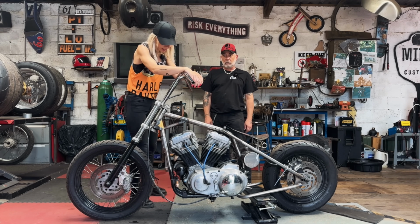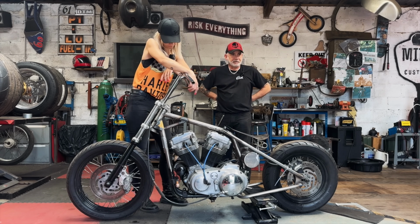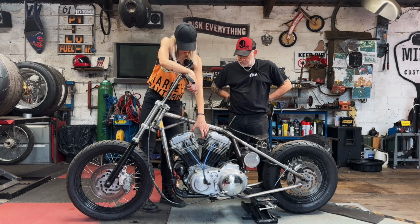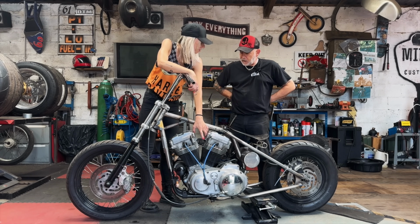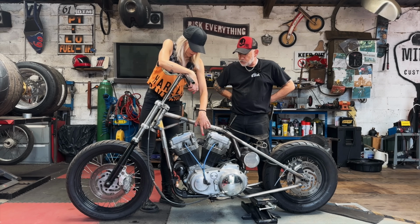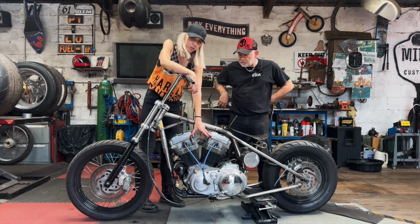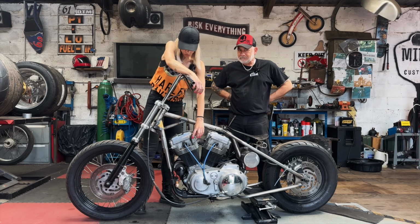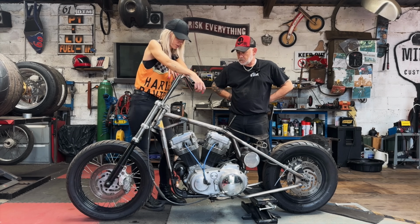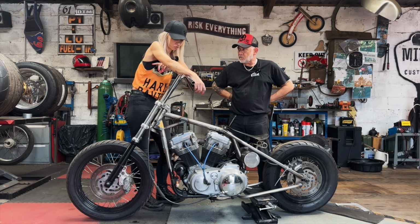But today's plan is to do a bracket for the coil, a coil mount bracket. And also, we need a little bit more strength in between the engine heads. Yeah, head steady. So that will come down there and it will be here. I looked at the different Mini builds, how Simon did engineering solutions of a bracket. And I really like when the bracket is already manufactured, but then adapted and changed. And I decided to do the original one.